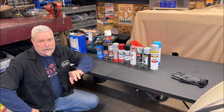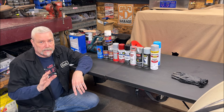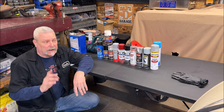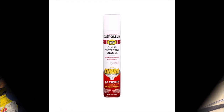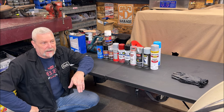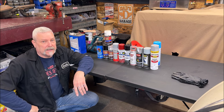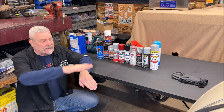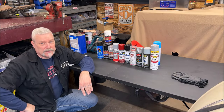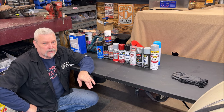A couple of different Rust-Oleums here. Before I start painting, Rust-Oleum does make a turbo spray that's supposed to spray four times faster to get the job done. I don't believe in rushing jobs, but I want to try it. The spray pattern is crazy — about six inches away it's seven and a half inches wide, so you can coat something pretty fast, especially for a quick paint job.